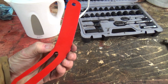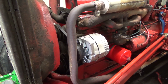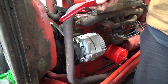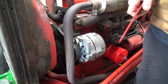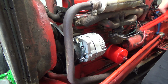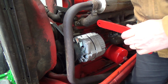And while we're waiting for that, I'll go and mount this guy on, tighten her up, and she should be good for that. All right, I know there were some comments a bit concerned about how close that belt is to the pipe here. You got to remember there's going to be a pile of air getting blown here too. So I'm not going to worry about that too much. And then when it shuts off, this stuff's so bloody thin, it's not going to stay too hot very long. There'll be more residual heat coming from the engine and the radiator probably than this thing here. So I'm not a whole bunch concerned about that part.